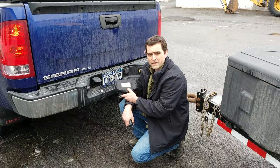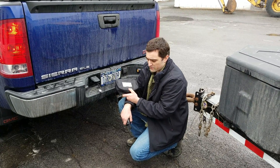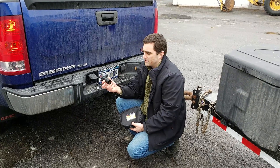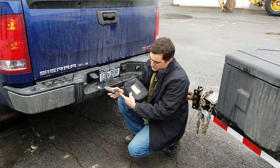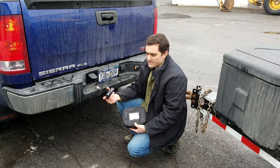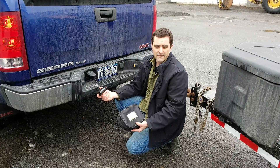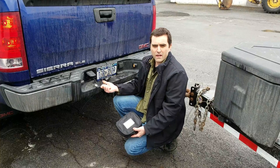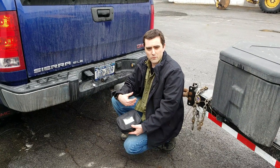I've been towing my trailer for a little while but I've suspected some issues with my integrated brake controller. The only tool I had was this other IPA tool — just a little plug-in unit. You plug it into the back and it tells you what circuits come on. The problem is it doesn't simulate a brake load, so I can't really work on the electric brakes or tell anything about them. I hooked up a couple of trailer brakes to the plug but all that was telling me is that they were connected to the truck — it wasn't telling me what my output was.